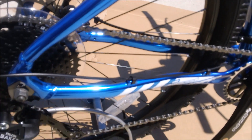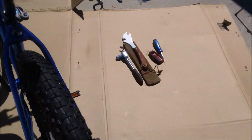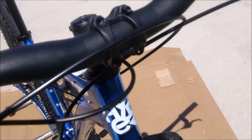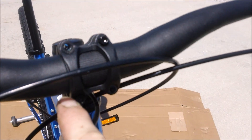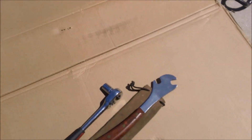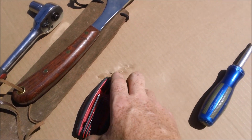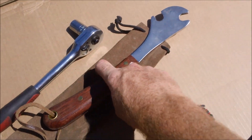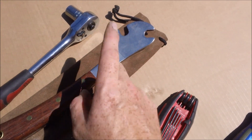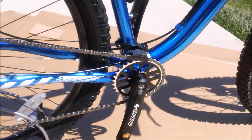It comes with a mechanical disc brake set which is an off-brand, and I'll do an overview video on that. The frame looks good and everything came together nicely. As for what you'll need to assemble it: remove the two reflectors — one off the seat post, one off the handlebar — with a Phillips screwdriver. You'll need Allen wrenches or a multi-tool set, a pedal wrench or applicable size, and a 15-millimeter socket or wrench to ensure the hubs are properly secured. Unfortunately it uses 15-millimeter bolt-on wheels, which will eventually get changed.